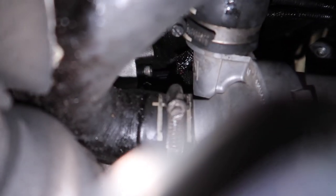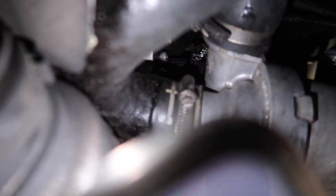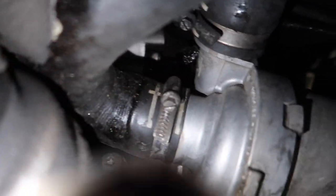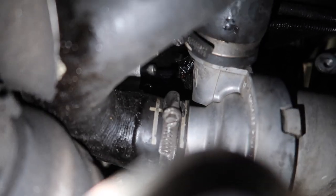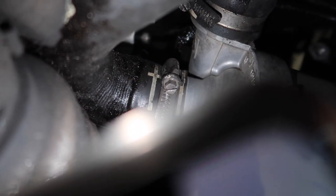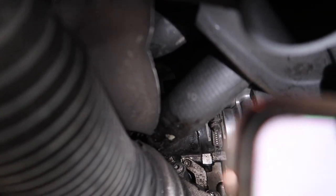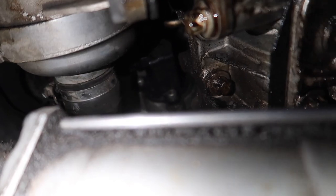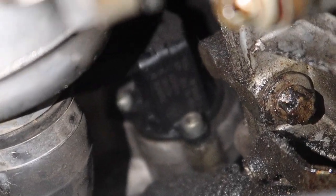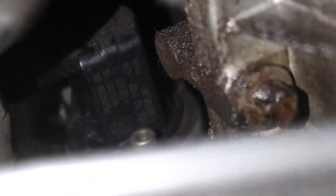The next step is actually unplugging the diverter valves. Right in there — you guys see that screw? That silver screw right there. That's the diverter valve, and that oily cable connected to it — that is what you need to unplug. Then we're gonna figure out if we take out those three screws for the diverter valve. It's called a diverter valve, not a blow valve. If you come up you can see all three screws. That's the first screw, second screw, and the third one is up there.